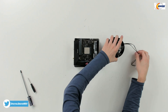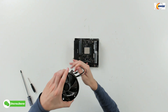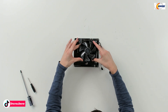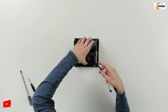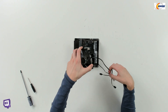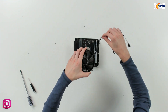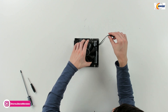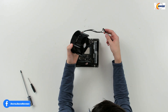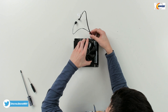Now we're ready to install the cooler. We already have pre-applied thermal paste with this cooler, which is nice, and we're ready to drop it right in. We put the bracket there — you can see it's only going to go one way. If you try to do it the wrong way, those screws aren't going to line up. Also at this stage for your cable management, I would recommend keeping the cables as close over to one side as possible as you drop it into place.